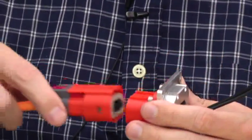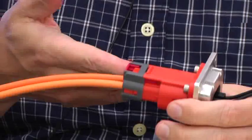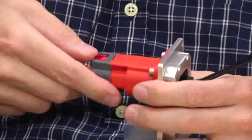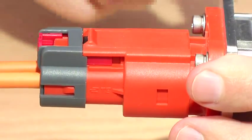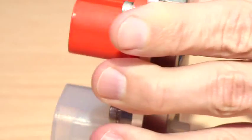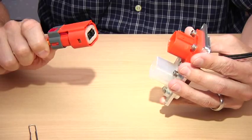What that does is it allows for a delay. We've also created a two-stage latch, and what's really innovative here is the fact that we were able to take all that complexity and move it into the area of where a standard latch would be. So as you unmate the connectors, you first depress the first latch which separates the HVIL. Now the battery is shutting down. Now the user has to go get their tool — a screwdriver, paper clip, whatever — depress it, and finish off the operation. There is a delay realized between the separation of the HVIL, the high-voltage interlock loop, and the high-voltage conductors, thereby assuring that you don't get a destructive arc when you separate the connectors and that there isn't live high-voltage.